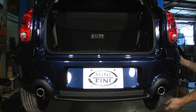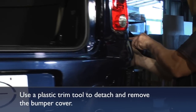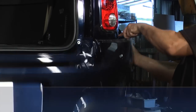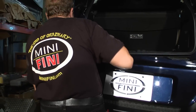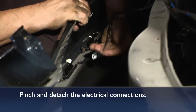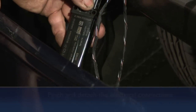You're then ready to start taking the bumper cover loose. Grab a hold of it on one side — there are cleats in there. Use a pry tool to help release the cleats on each side and then the bumper cover pulls away from the vehicle. Disconnect all of the electrical connections for your lights, then take the TPMS antenna loose from its bracket.